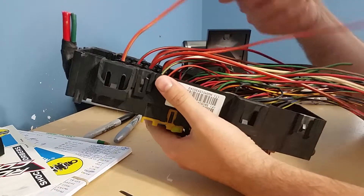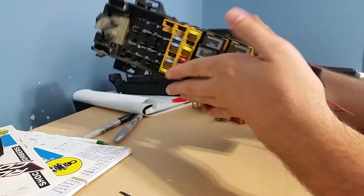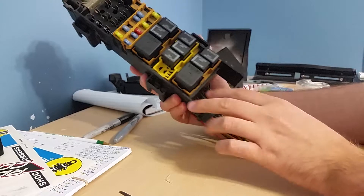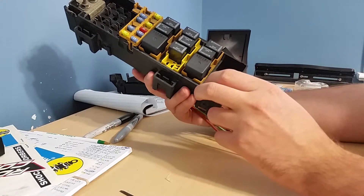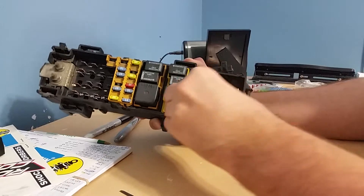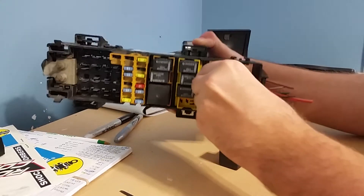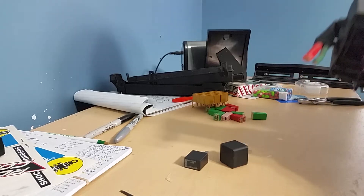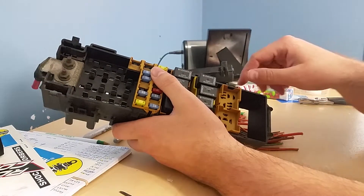That's a great and easy way to add some extra fuses to your box if you've got some open spaces. These are the two big relays for the 4.0 Jeeps with the high and low fan. What I did is take the relays out — sometimes a little tough if they've never been out before. Once you have those out you're left with this yellow tray again.